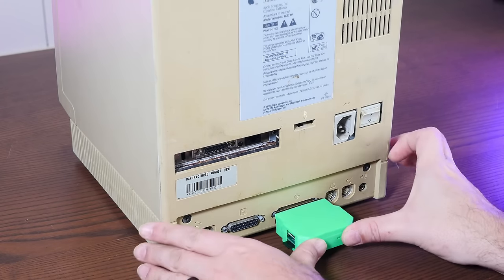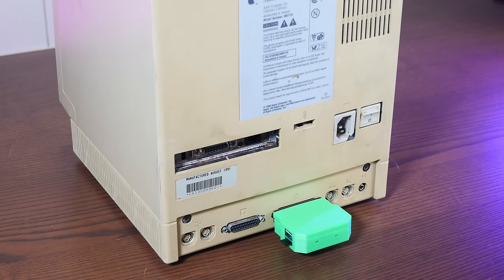Now, back in the day, it would have been very difficult to verify Micromac's claims of SE30-like performance out of your Mac Plus, and I'm a little suspicious of that claim for a couple of reasons we'll get into later. But for now, I want to test it using a little bit of modern Macintosh magic: the venerable Blue SCSI. This is an external Blue SCSI with a DB25 connector, so we can plug it into the back of both machines and boot from it like a real SCSI hard drive. I have an image on here with a fresh install of macOS 7.1, which is a perfectly reasonable operating system for the SE30. We'll run some benchmarks with MacBench 2.0 before and after the upgrade and see how this really compares to an SE30. Our Blue SCSI plugs right into the SCSI port on the back of the SE30.